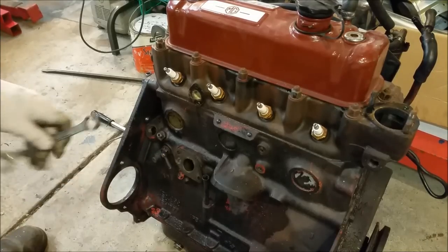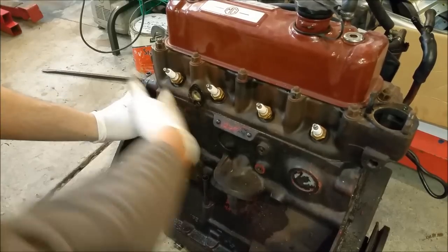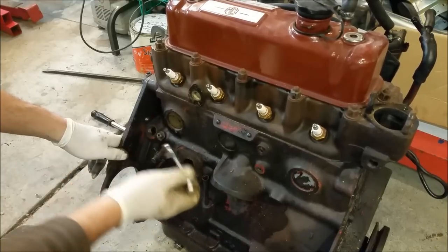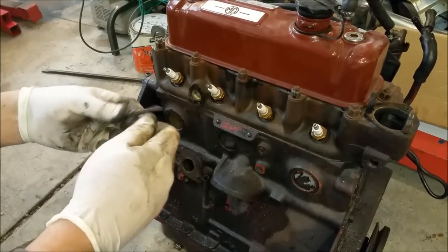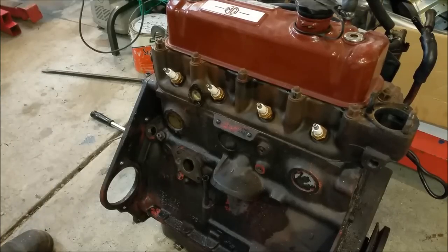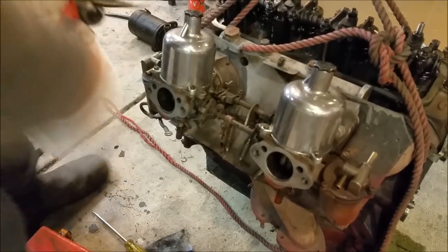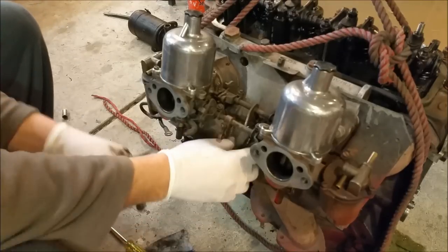That's steel so it'll look good being plated. It's got this beautiful period tap - it's seized, but actually it's just moving. I can free that - I think it's brass, so I'll be a little bit ginger with it when I take it out. I'm sure I've got one out of an EH Holden somewhere. We need to polish that. This goes straight to the water gallery - it just helps to drain the block. That's a gorgeous bit of kit. That's what these old engines need to showcase them, and have it pointing the right way so it looks like a tap. That's lovely.